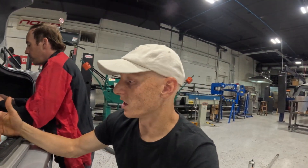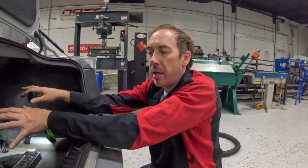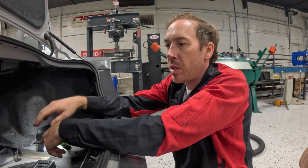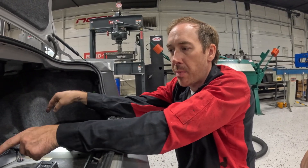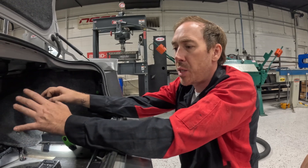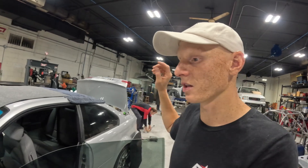So would you say we've kind of gone above and beyond what the normal subframe fix would be? Absolutely. The normal subframe fix is what we've done — this is just kind of that next level. This is kind of your weekend warrior repair. Anything above this, if someone were going to actually track the car and race it, we'd go full ham on it and tie the cage into the top sides of these subframe mounting points — that is the end-result repair. But for most HPDE days and track warriors, this is sufficient. And what's cool is by the time we put the last bits of the interior in, you're not even really going to be able to tell that this took place, and that's exactly what the customer wants.